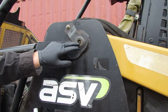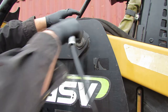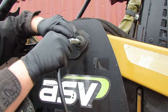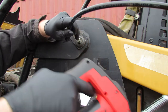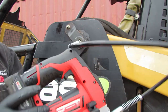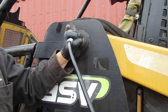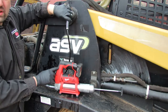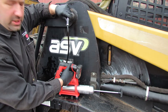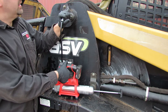There's our zerk fitting inside of here where the pin is. Snap that on there. This is not a lock-lube or anything so it just doesn't have the lever on it — I really like those and might try one on here. Let's put that on there and pull the trigger. This doesn't have any adjustments for how many pumps like the M18 does, so you kind of just pump it till grease comes out. It does have a battery gauge right here that shows how much battery is left when you pull the trigger — it doesn't stay on all the time.